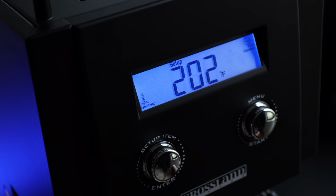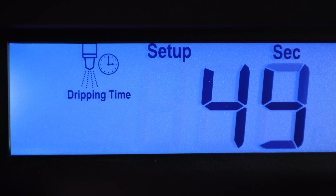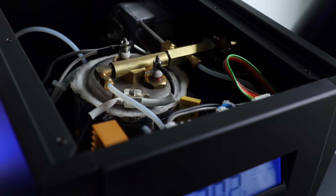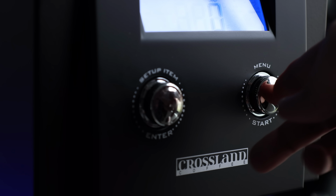And we'll get more into using the settings in the next section, but for now, as a brief overview, there are some main points of interest. To start, there are 3 espresso shot settings that allow you to adjust pre-steam, which is actually pre-infusion, the wait time, which allows the water to saturate and essentially bloom and expand your grinds, and the dripping time, which is the total shot time that includes both pre-steam and wait times. Of course, as you'd expect with control over all of those settings, you've also got PID control over the single 500 mL stainless steel boiler. But unexpectedly, the PID settings also allow you to set a brew temperature per shot program, which coupled with all the other settings, allows you to have a range of shot styles at the press of a button.